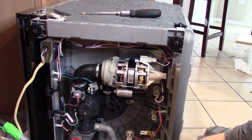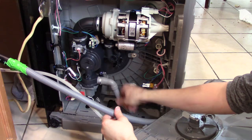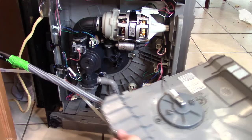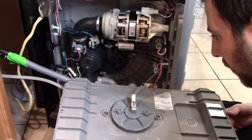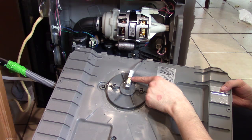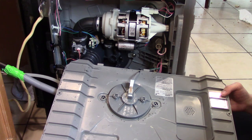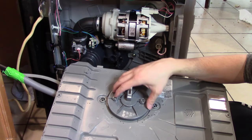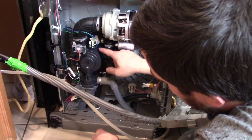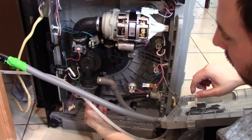If you've never seen the inside of a dishwasher, it's a little bit more complicated than what it might seem. This must just be the drain tubing. Looking at it, it doesn't feel wet — it doesn't feel like it's actually leaking. Looking in the drip pan itself, it's kind of gross — looks like there's some dead ants or bugs or something, but it seems basically fine. I think the way this works is it's got two metal prongs right here. If the drip pan gets filled with water, it completes the circuit between these two metal prongs and that trips the device, making it think the whole thing is flooding. What originally happened is the dishwasher wasn't draining out, so there was excess water that went in here and tripped that sensor. But the root cause of the issue is actually the impeller — this right here is where the actual impeller is located. So first I'll disconnect the power from it.